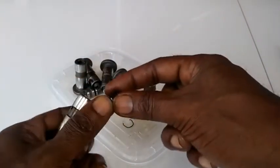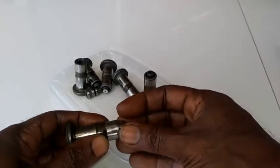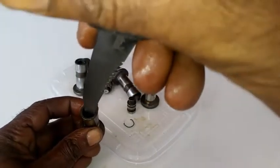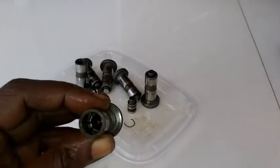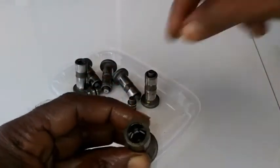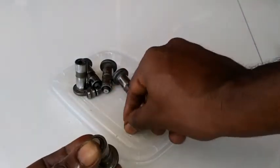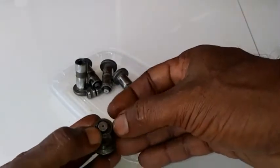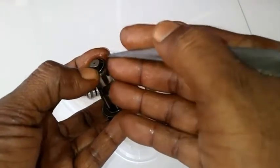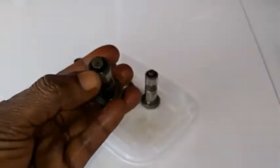Take this spring and place it onto the bottom of this plunger, then drop this in, making sure that the plunger seats all the way down. You can see right there it's all the way to the bottom, which lets you know that the spring is seated in the groove at the bottom of the hydraulic lifter body. Then place this plunger in and put this C-clip back — this is going to be a little challenging. This is why I recommend new hydraulic lifters instead of messing around with this one.